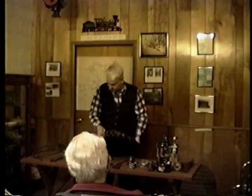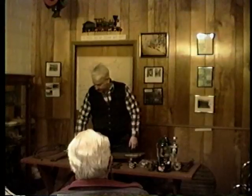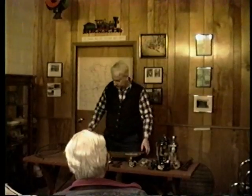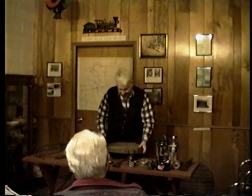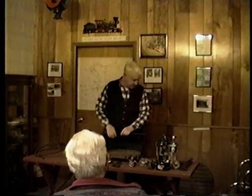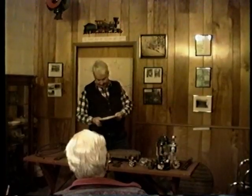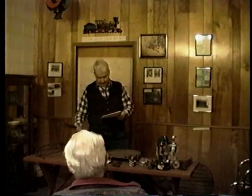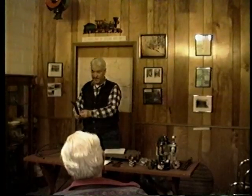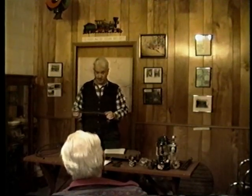And they used a pilot. It was a separate pilot from the earlier cars that didn't have a pilot. And this is the vaporizer that they used. Turn this over. Vaporizer would have come across like so. There was a pilot and a vaporizer, and inside the vaporizer, this is an early vaporizer, there were cables, and the cables were put in there to force the fuel to the outside of the tube, and the outside of the tube is the hottest part of the tube, so the fuel vaporized faster being forced to the outside of the tube.